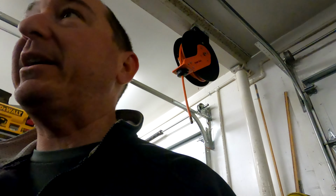Okay, one last thing to check before I condemn this fuel pump is what looks to be a pressure regulator, this thing here. So this is the input side. I'm going to take this off, turn the key on, and see what the flow looks like out of just the raw supply there. Action shot. That is why you diagnose things before you just go replacing. Even though that pump is making a god-awful racket, it is actually moving fuel up to the top, up to the front of the engine.